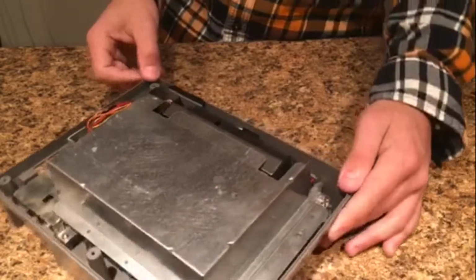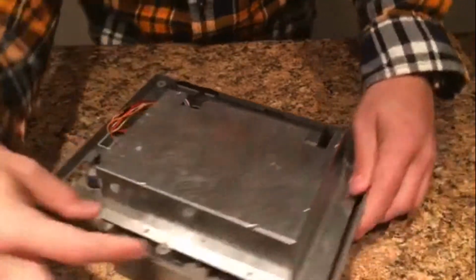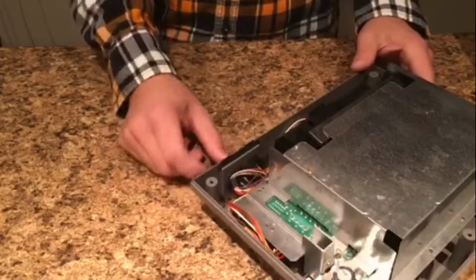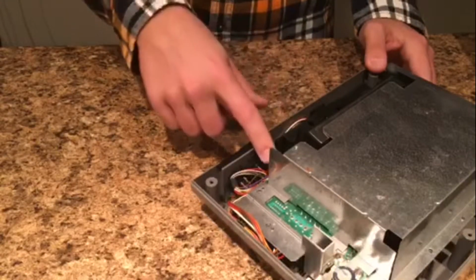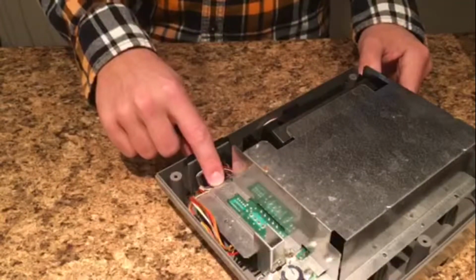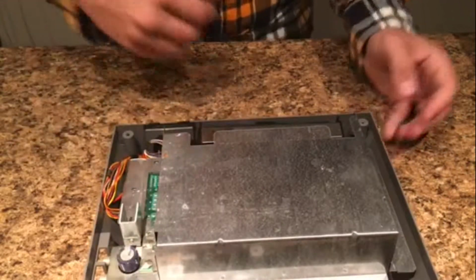So now you got to put in your screws. There's 7 screws for this thing, so that's a lot. There's 2 over here, there's 2 in the back, then there's 1 right there, and then 2 over here. And as I was saying before, any screws that are around the middle of the console are the ones that you don't want to tighten. Like this one over here, we didn't want to tighten too much, if you can see. So this one, you don't want to tighten too much either. And I'll show you again whenever we come back. But so go ahead and put all 7 screws in.